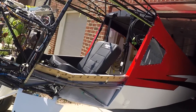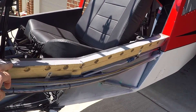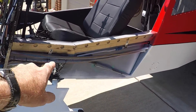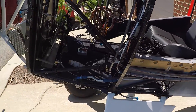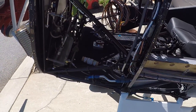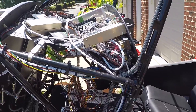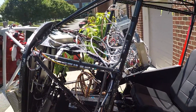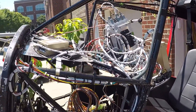Starting back here — this is a panel that sits below the threshold, which is a raised threshold because we're going to have a gull-wing door on this Bearhawk. That panel's all completed, everything's wired. I just have the panel off for simple access. The boot cowl is done — bottom boot cowl all the way up to the top. I've designed it so a panel sits up here at the top that allows access to the back of the panel, and I can tilt this panel out, which is really handy for maintenance.